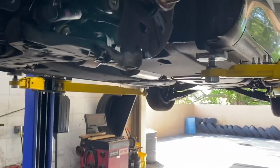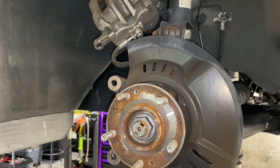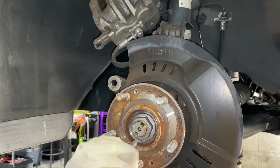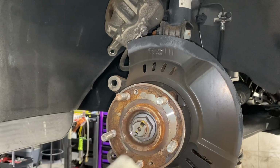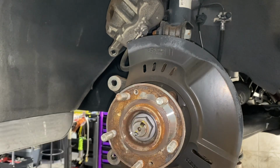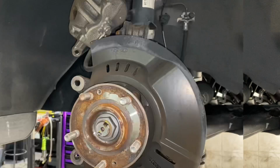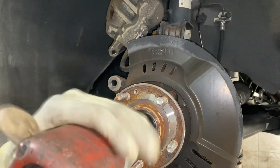So let's come up to this guy here now. Now you see these 2 divots in the axle. I don't want to disturb them. So what I'm going to do is this. I use my ball punch and just squeeze in there. Now, when you tighten back your axles, these may not be your points, but you must put them back into this locking unit. And that's a 32mm. So, 32mm axle bolt.